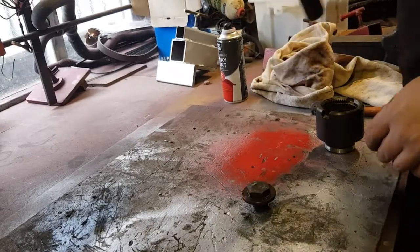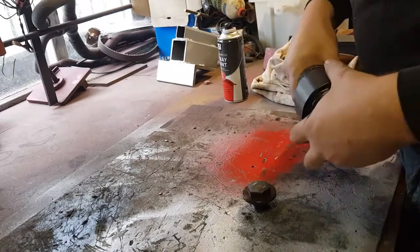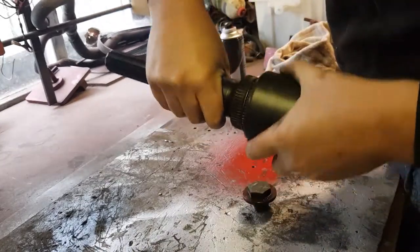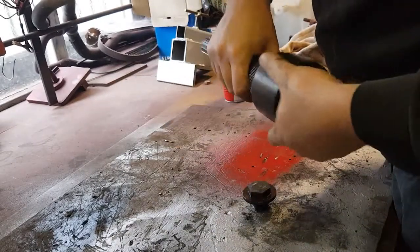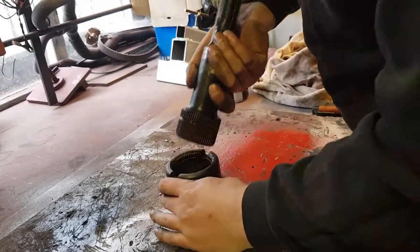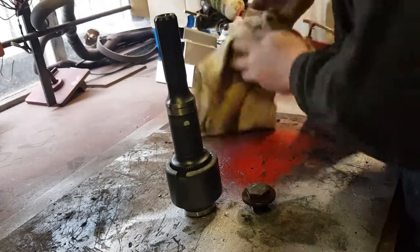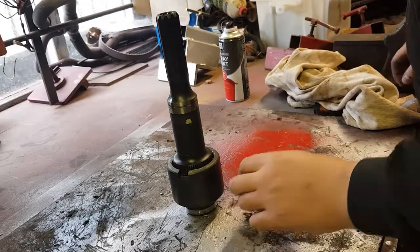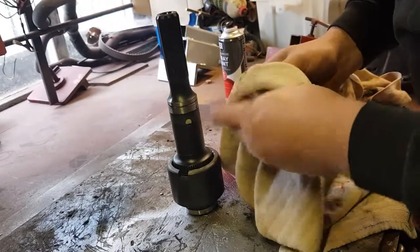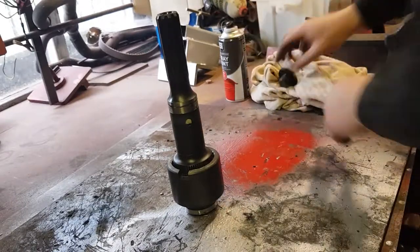So this is the output shaft that wears on the Puma — well, I've cleaned mine up. You can do this in situ with the gearbox still in the car. Mine isn't too bad. But getting the transfer box off the gearbox was another story — when I took it off, this was completely seized together. With the gearbox still in the car, this would have been a great job to do. But it's a must thing to do while the gearbox is out, if you're having a clutch done, because they suffer with them so bad.